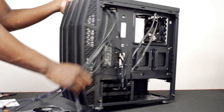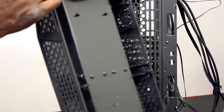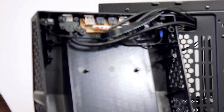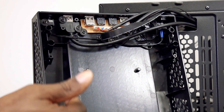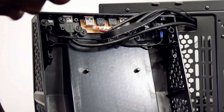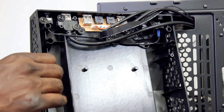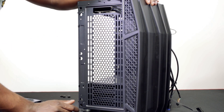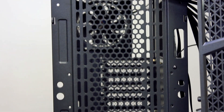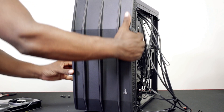Let me pull the front off real quick without trying to break anything. The cables are attached to the front of the case itself, with plugs that go straight in — they don't look glued in and it looks like you can still prise them out, no problem. And then obviously USB 3 and everything. The RGBs are in there as well. It has got a decent width for cooling on the side there — depending on what you're going to put in the front, you can put a 280, or a 2x140 radiator, or 3x120mm fans on there.